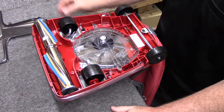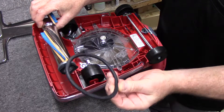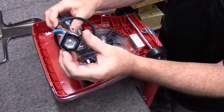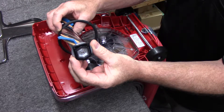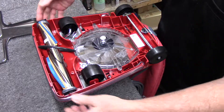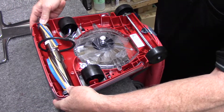Here I'm lined up — that's step one. Pull the brush roller up with my right hand. Take our new factory original belt and set it in the center. Then I'm going to make sure that my arrows are pointing down, and I'm going to set it just like how it's supposed to go and press straight down. This one is straight down.